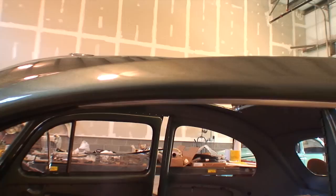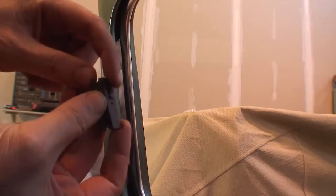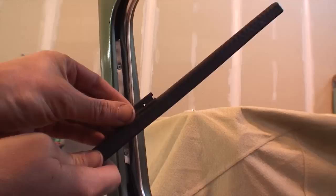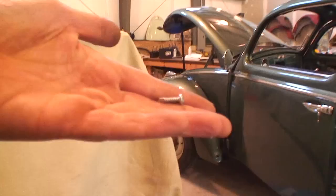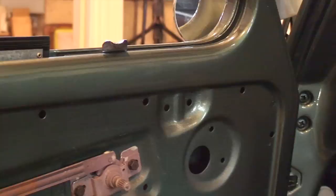Our outside scraper is now in and fastened. As you can see, if you have a later bug, the chrome is going to go up past into the vent window area, and there's a tab that holds that in. The later bugs also have these clips that hold the chrome in — they don't use screws. You put a clip in there and the clip goes into a hole. There's like an ear on the clip that goes into a slot and holds the chrome in place. Then you put your felt channel in afterwards and the clip holds it in because it has some teeth to hold the felt channel. This could be a little difficult to do. If you don't want to do it this way, you could do it the old-style way with some self-tapper screws from the hardware store.